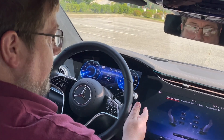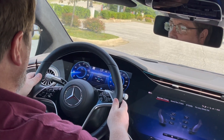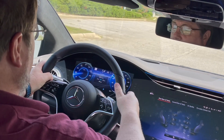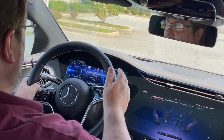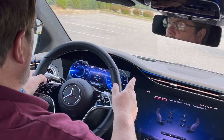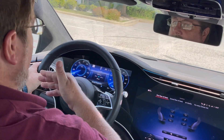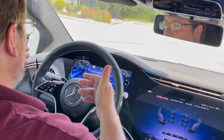the car gradually slows down. If you're going faster, it slows down some, but not dramatically. The key for single pedal driving is: as you're driving at speed, you take your foot off the accelerator and normal recuperation will start slowing you down. Then you go to strong recuperation and then back off to normal, and as you slowly glide to a stop, you hit the strong to kind of finish it off.